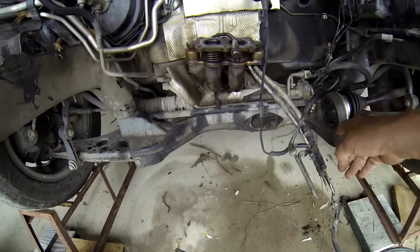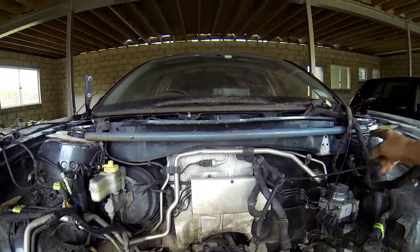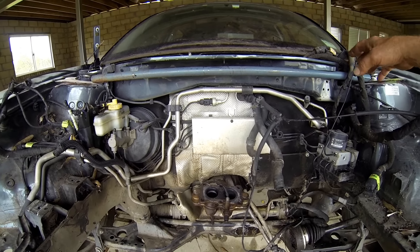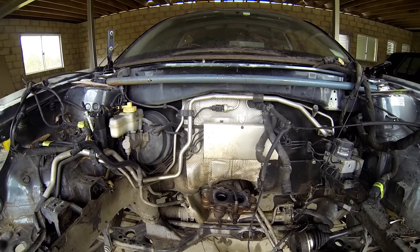So I'll have a bar across the bottom and then a bar across the top so that becomes a complete rectangle that makes the suspension work a whole lot better and takes the stress of running on gravel off the chassis of the car itself, where things can crack and break.